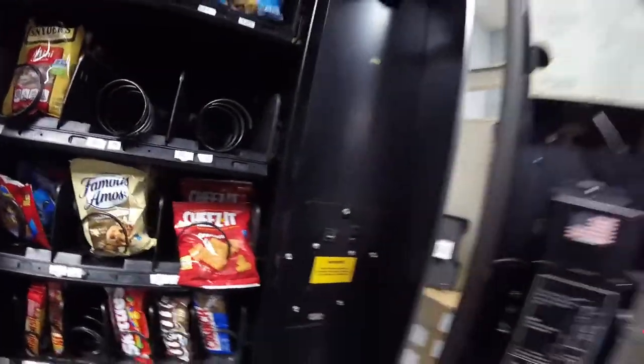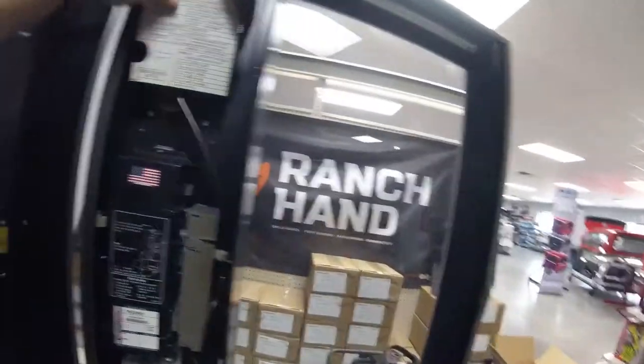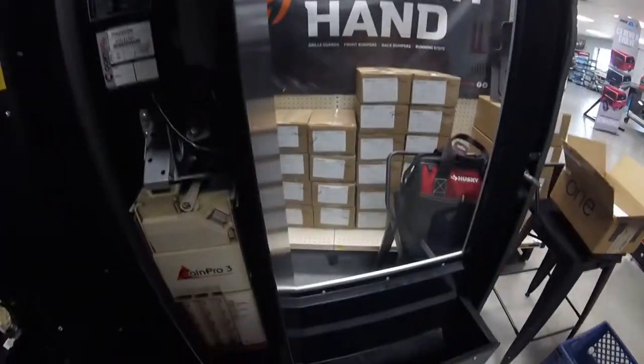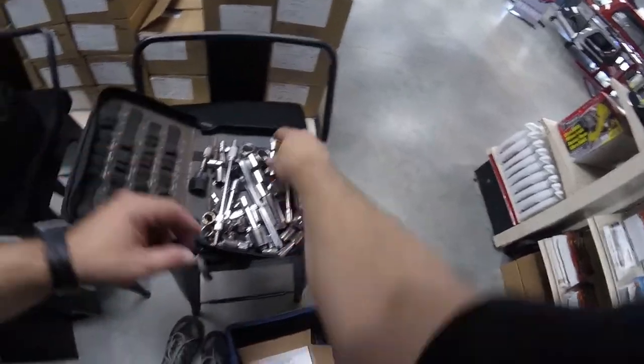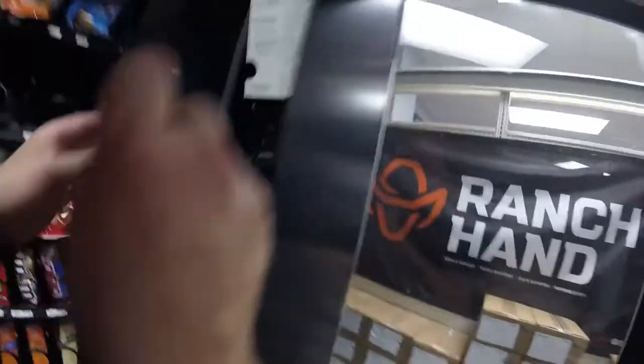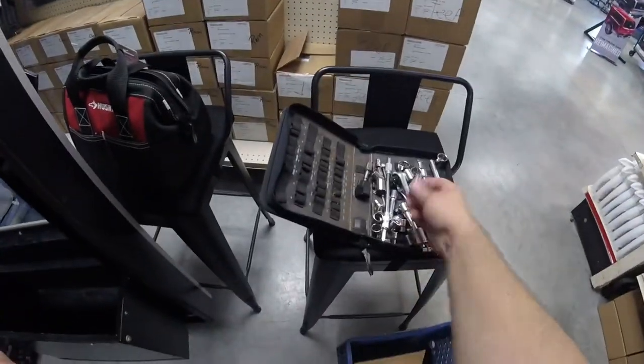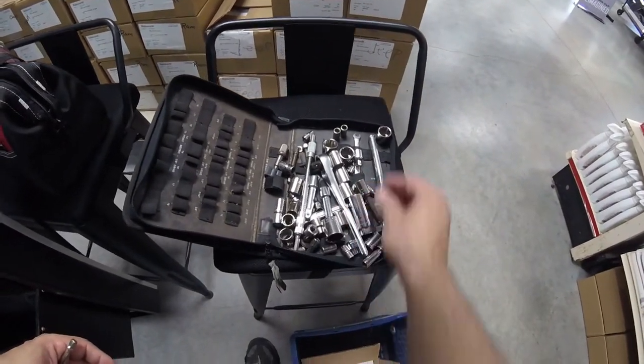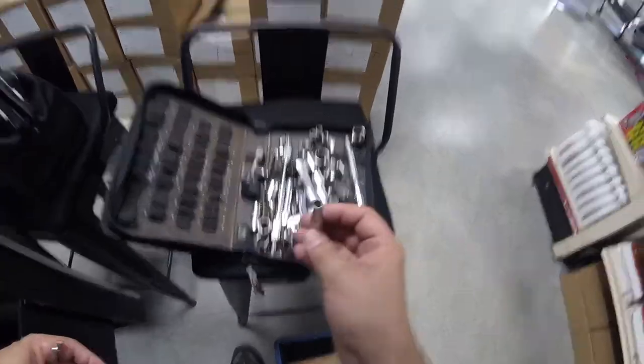With our inventory done, let's first power the machine off — that's very important. Now I need to remove the cover piece that goes over the old controller board. I've got my ratchet set, screwdrivers, and all kinds of tools. I'll find the right socket to fit those nuts, remove the cover piece, then remove the controller board, unplug all the wires, and start installing the new controller board. This process was actually very easy — I was surprised with how easy the upgrade was.